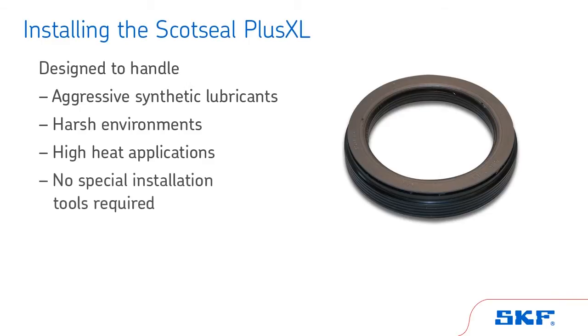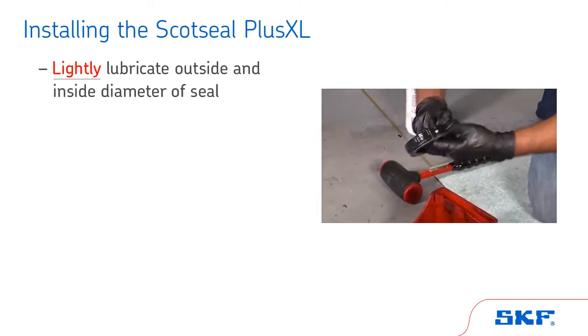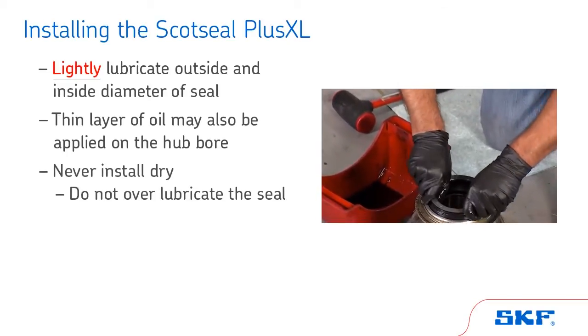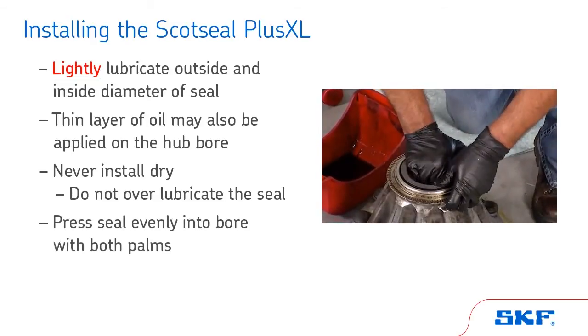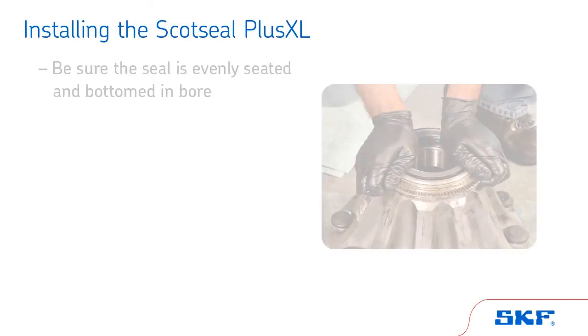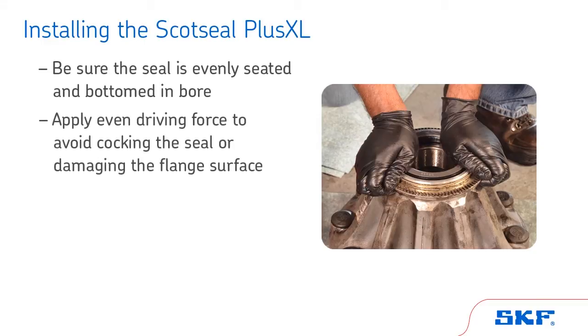No special installation tools are required. Just lightly lubricate the outside and inside diameter of the seal with a wheel end lubricant. A thin layer of oil may be applied to the hub bore. Never install dry and do not over lubricate the seal. Press the seal evenly into the bore with both palms. A rubber mallet or soft face tool may be used to gently tap the seal into place. Be sure the seal is evenly seated and bottomed in the bore. As in any seal installation, apply an even driving force to avoid cocking the seal or damaging the flange surface.